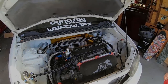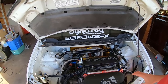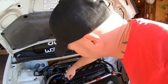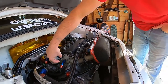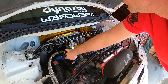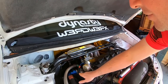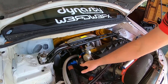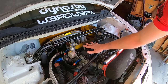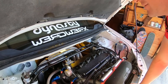So tell us what we're staring at — one of my nightmares coming to fruition. This is H22 number four and a half. The head is obviously reversed. We had to weld a plate and pull out the two cooling plugs that were originally on this side of the head so we could get coolant in here for the main radiator hoses and the thermostat housing. My original plans were to run it with the distributor, but the third ear of the distributor wanted to occupy the same space as the thermostat housing, so we went with the AEM engine positioning module. It's probably for the better — the coil packs put out a lot more power than the old distributors.